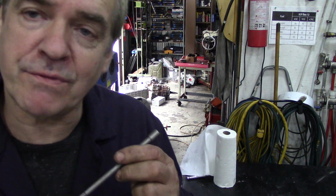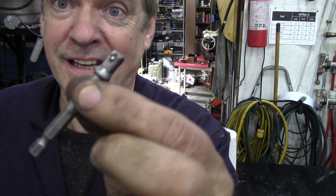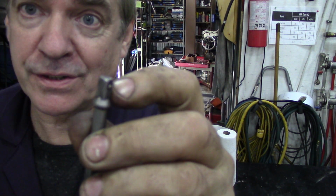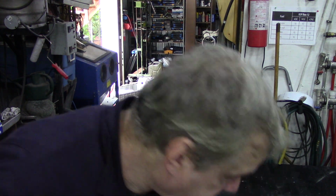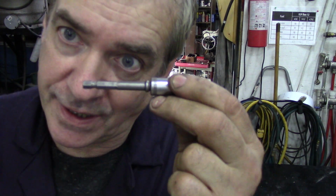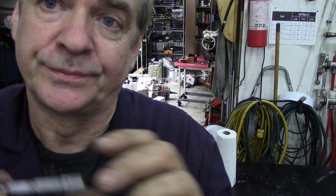Yeah, where was I? You can whiz round all your nuts and bolts, or all your hose clips in seconds with that. So that's a good tool. But there also exists an even better set of bits and pieces, like this. Now this is like a 1/4 inch hex that goes into your gun, but it's also got a square quarter drive on the other end. And that means that sometimes you get studs, nuts and studs. Like for example your speedo drive, those sockets here, wait a minute, they're too shallow. So you get a little adapter like this, and you can get the ones with the studs and the nuts off. You understand? Because when the stud's really long, you can't get these in.